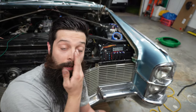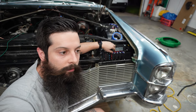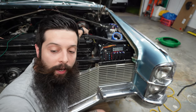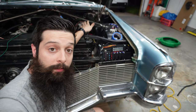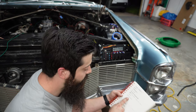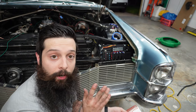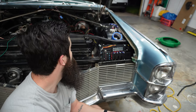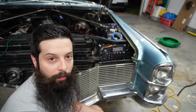I think I've got to call it a night. I've just about got everything wired in that I want to. The only thing I haven't done is the blower motor, because it requires me to add that resistor and I'm not quite sure where I want to put it, but everything else is pretty much good to go. I still want to rig a voltmeter — I'll make sure everything's working before I really start tucking it away. It's going to clean it up so much, so I'm really looking forward to doing that.